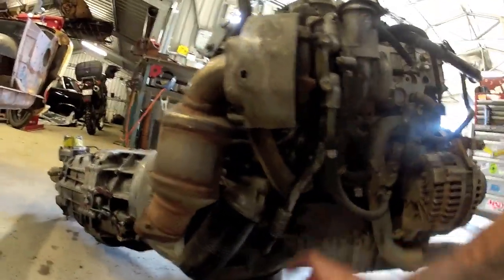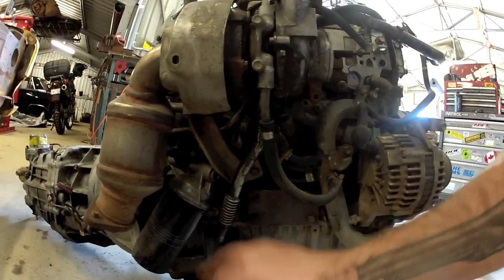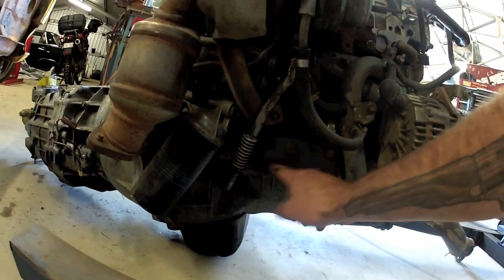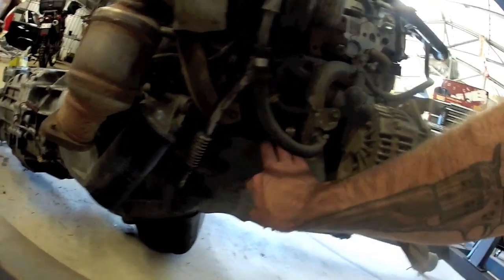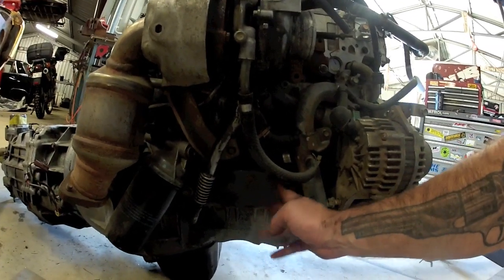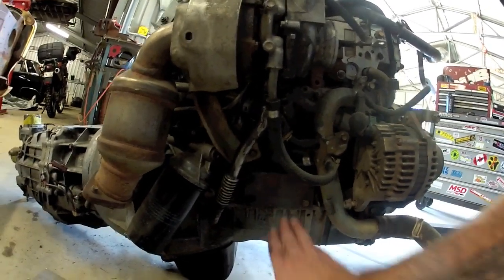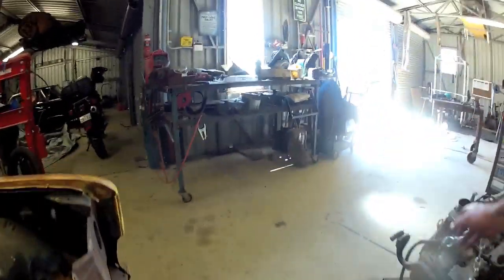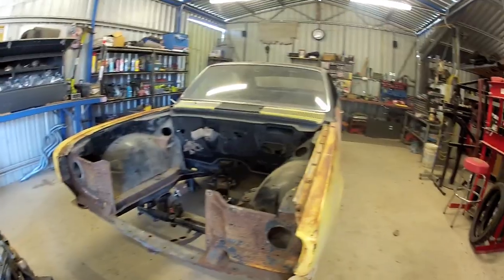Well, it can't be flat because the block is not even on the other side like this side, but I've made a plate there, drilled it, just got some random bolts there just holding it for the time being. So same thing here, we'll have plates coming down and then probably gusseted between them. That'll come down onto that plate. So, got that in place, that one in place. I'll probably rip those out just to get it back in there to give me more room.